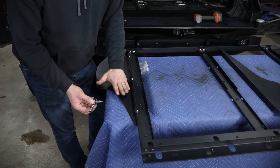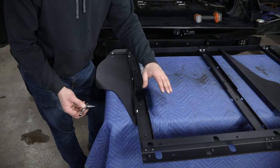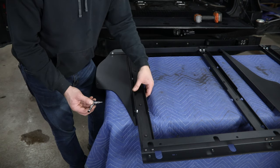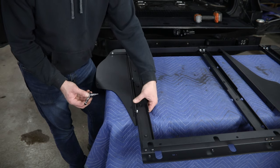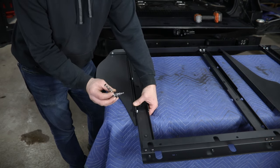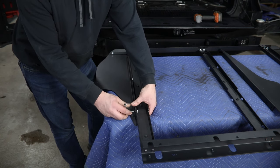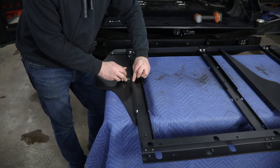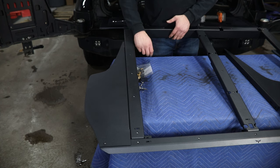This panel, once installed, should be level with the actual floor panels that bolt to our frame, so it will be raised up from the top of this rail in the other orientation. That should leave it pretty much even where the two meet right here. We did switch to a 5/32" allen driver on a ratchet just because we can't really spin our T-handle once we get up toward the larger section of this panel. Once you have all those bolts tight you can repeat that process on the opposite side.